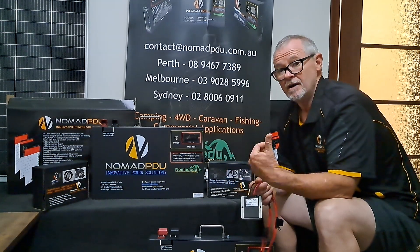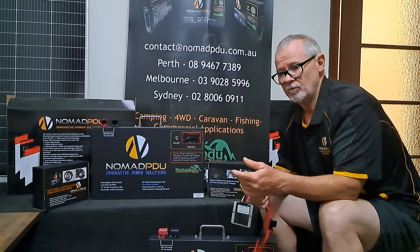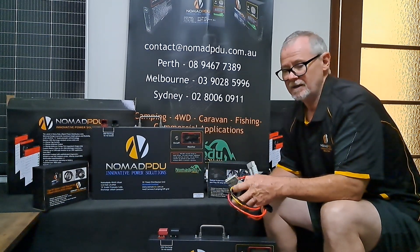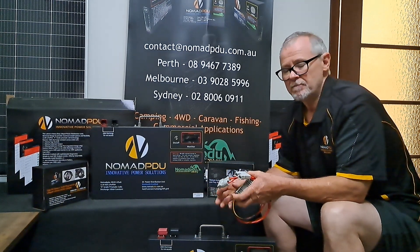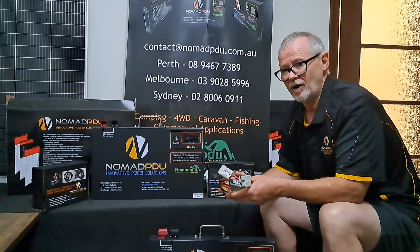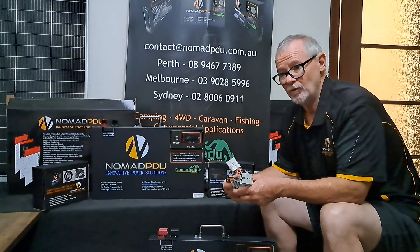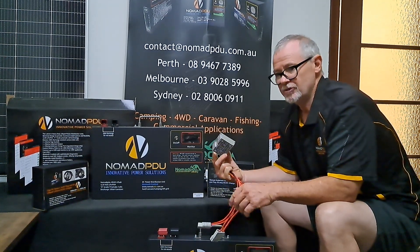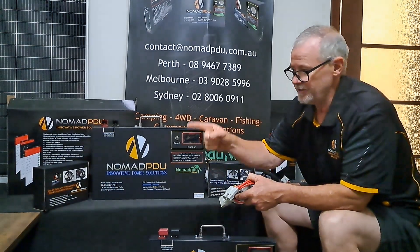Get a clean run from the vehicle — check for a cavity between the engine bay through to where you want to put the DC. We typically put the DC-DC close to our units, but you may need to put it near the front — that's fine. Always fuse it, and read the instructions on the DC-DC unit and follow them. Please don't run substandard cabling, and do not use AC cabling just because it looks like it'll do the job. Go to a proper four-wheel drive or cabling store and buy cabling rated for DC — get the right AWG for the load, because if your fuse is rated higher than your cable, the cable will melt first.